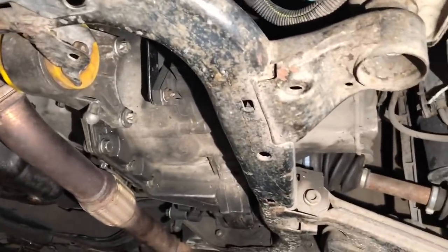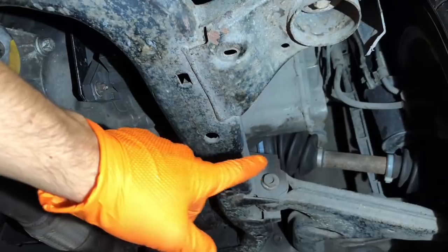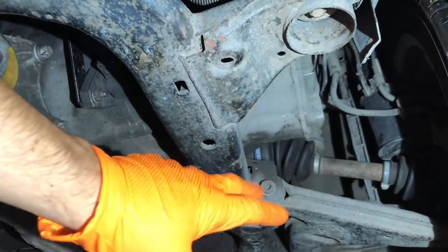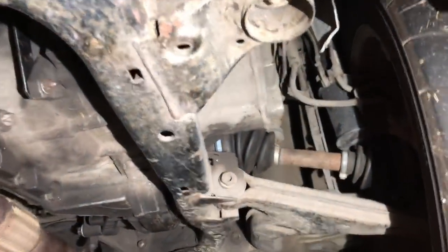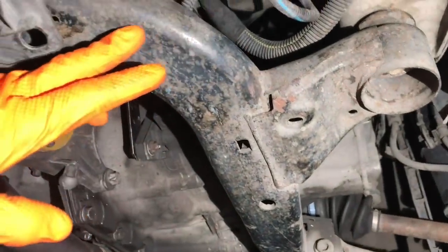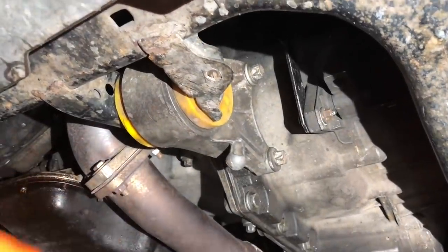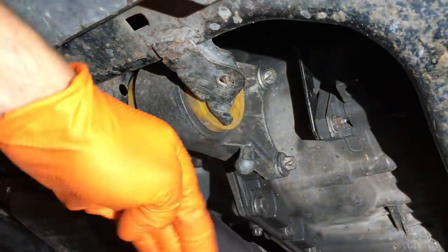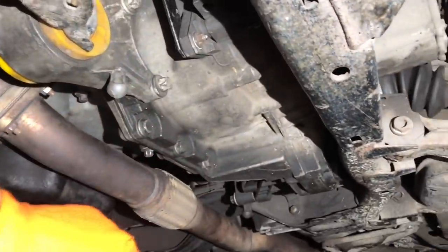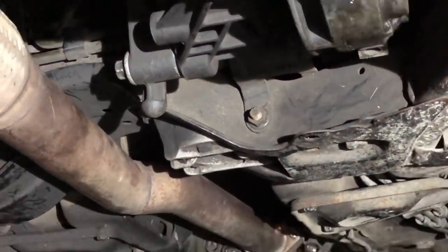After a lot of work - you took it apart so you know how to put it back together - the subframe and everything is back together now. The driveshaft on the short shaft side has been replaced because the inner CV gaiter had split and I didn't have a spare, so I replaced it with another shaft. Also fitted a Powerflex front mount - it was off an Astra but fits straight onto the Safire, same Z20LET engine, F23 gearbox - stops the front lifting up and rocking. The clutch judder and knackered flywheel had ruined both the front and rear mounts, so the rear mount has been replaced too with a good one.